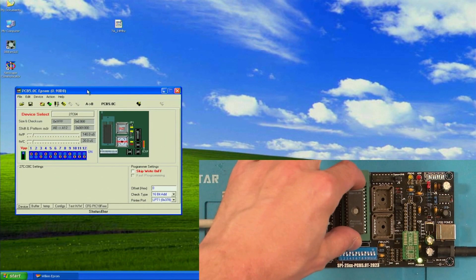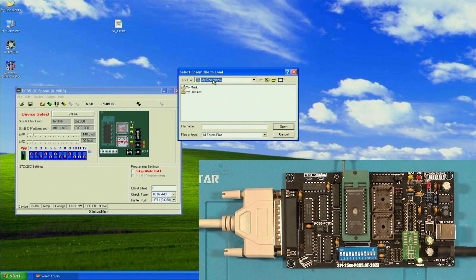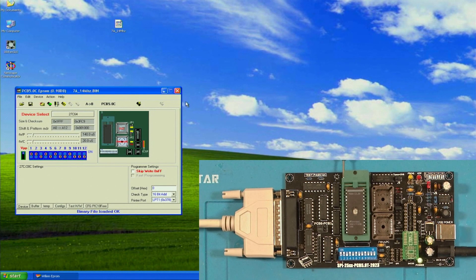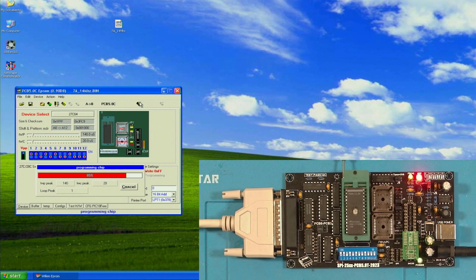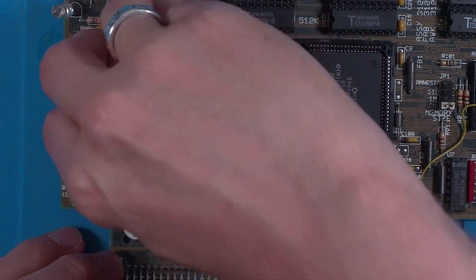With all that done, and for the A590 mod to actually work, the ROM needs to be updated too. Otherwise, the A590 won't correctly set up the SCSI controller chip into 14MHz mode. Now there's a hacked binddrivers file you can find on various Amiga forums, but I thought I'd try out a new old toy. I bought an EEPROM programmer, and the design's so old that it needs a parallel port to work, and it has to be a real one too, not a USB adapter. The only machine I have that has one is my old Dell laptop from about 20 years ago, happily still running Windows XP. We only need to program one of the chips — the odd ROM — as the other one wasn't modded, and you can see it really doesn't take very long. With that done, I'm going to rerun the speed test to see if it made any difference. So let's get that ROM installed.